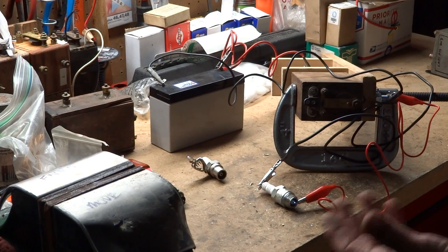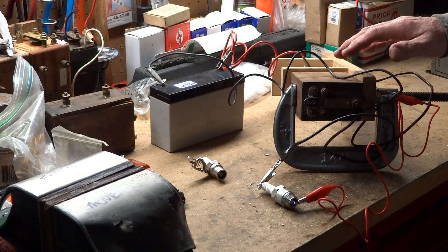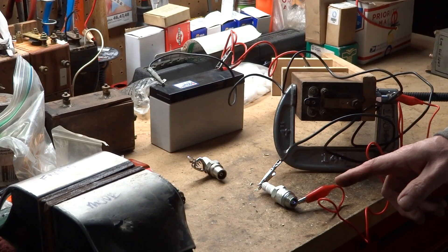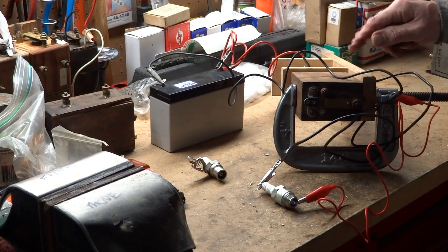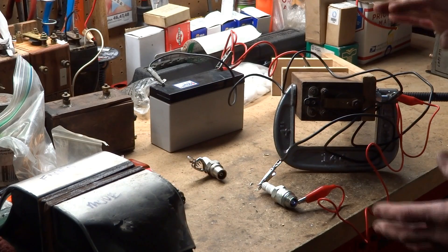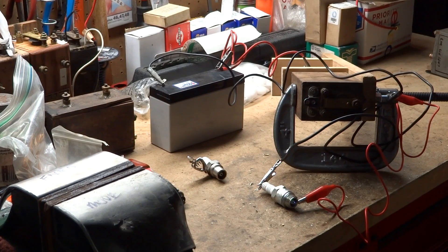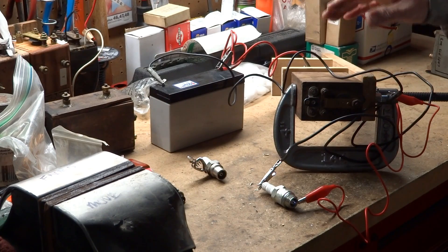Now I'm going to show you what we're going to do to get this thing to work better. I don't want to use the test plug because when this coil sees power it will make a spark somewhere — either it's making it outside on a plug, or it's making it inside and it's burning up the windings inside. You never want to run one of these coils without having a gap to allow the spark to jump. A spark will be created every time positive and negative is placed to this, so you do not want to operate one of these coils without a load on it.